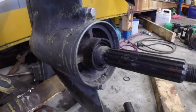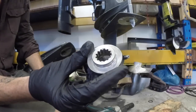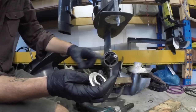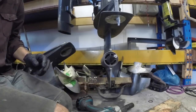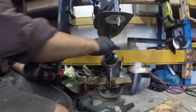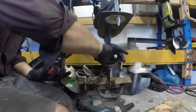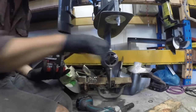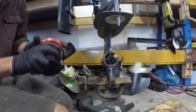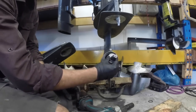So now I'm going to clean this shaft up a little bit, clean this thrust washer up, and we'll go through the reassembly. The thrust washer's cleaned up now, looking a bit better, and the prop shaft's had a bit of a brush and a wipe. First thing we'll do is just put a bit of grease on this shaft, just wipe a bit of the excess off, then the thrust washer on towards the back.